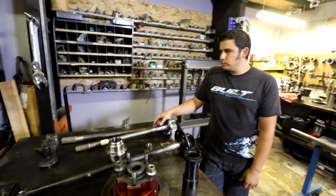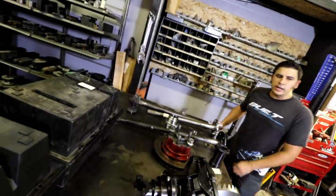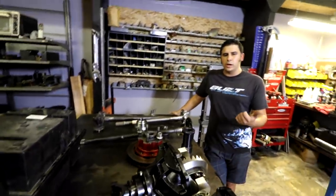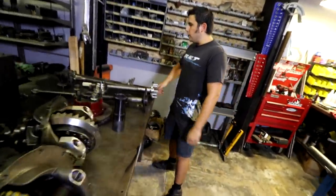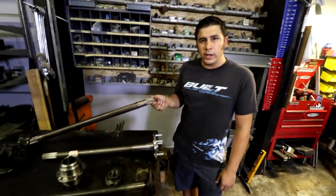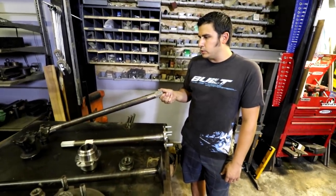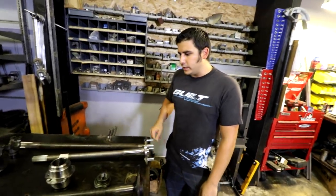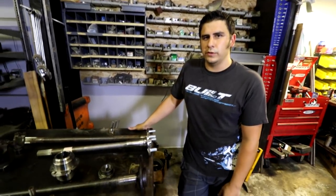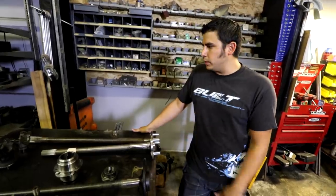You were telling me earlier, so that full float axle you have down there is not a trophy truck axle, right? No, this is a 35 spline axle. So factory axles from like the junkyard will come with either 28 spline or 31 spline. This is a 35 spline, which is a good upgrade and will take a lot of abuse. But this chromoly axle, the opposing one, actually snapped in two back in the day in my Ford Ranger with 35s when it was on the small tire. So you can kill them. And so typical 40 spline will be next option.